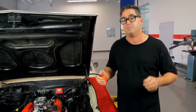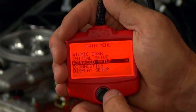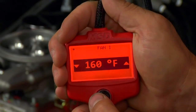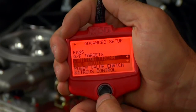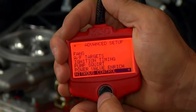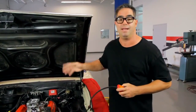MSD has truly simplified EFI. Going a step further, there is also an advanced calibration option allowing you to control when the cooling fans come on — first and second, maybe at 160 or 180 degrees. Additionally, air-fuel targets can be calibrated, you can play with the ignition timing, the pump squirt, the accelerator pump, power valve enrichment, and also nitrous oxide control. But since we're just getting it started, we're going to go with the initial setup and hit the road.